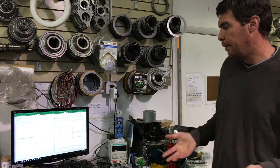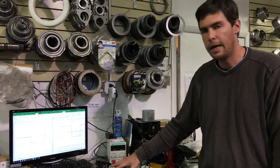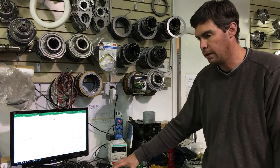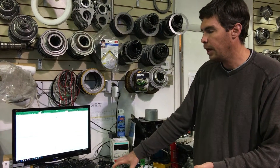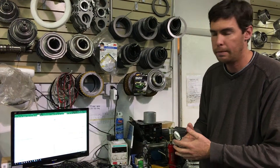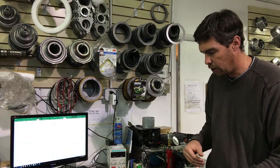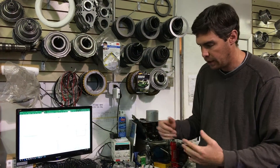To combat that, what we did is we installed stops inside our selector valve body to prevent overextension of the fork and synchro sleeve. So if you have a CBA with this weak synchro sleeve and the weak stops that always break, this resolves that issue because it's no longer slamming into the stops. The beauty of this design is, if you limit the piston throw, it's no longer bottoming out on the sleeve or the fork, and it's taking pressure away from that system. So once the gear is selected, everything sits at a nice idle position with no constant pressure.